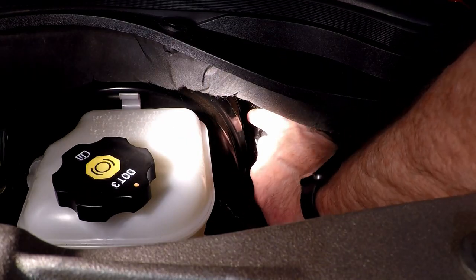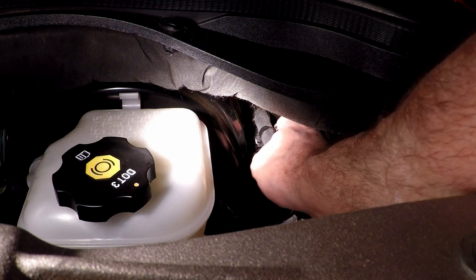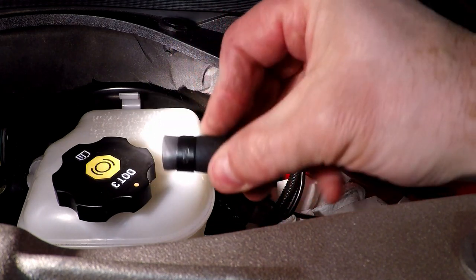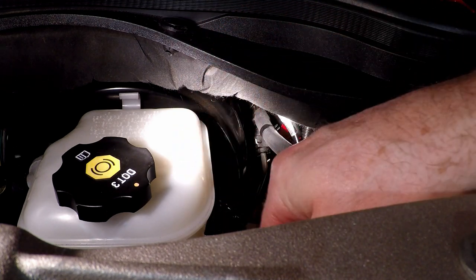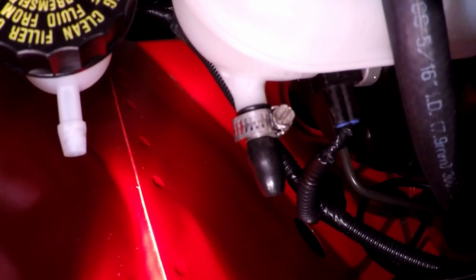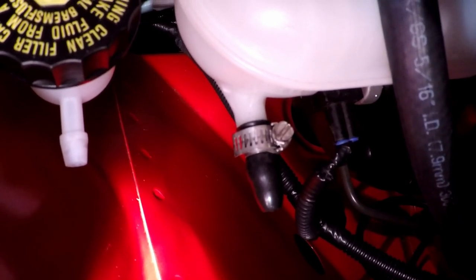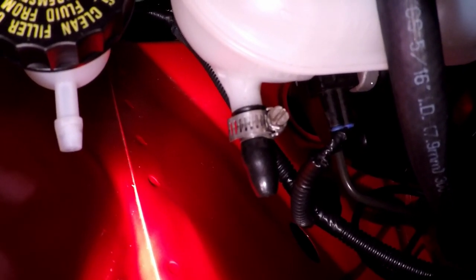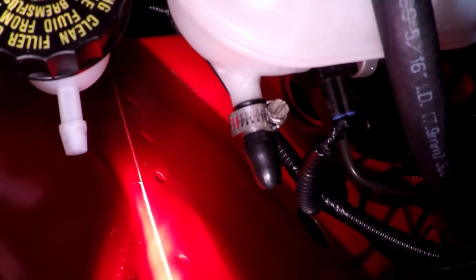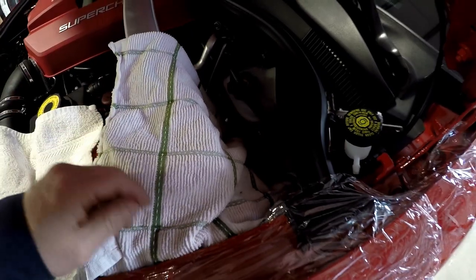I can feel the barb is well seated. I moved the clamp over against the base and then popped it onto the reservoir. I went to the store and got some proper worm gear clamps — I just don't like the clamps that came in the kit; they don't put enough clamping force for my liking. I'll keep an eye on that cap to see how well it holds up being exposed to brake fluid — it's in the kit so it's probably okay, but I'll be looking for a more permanent solution.